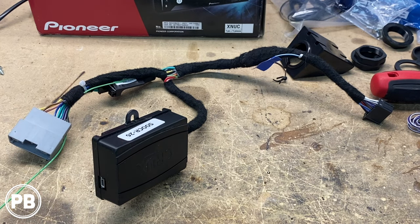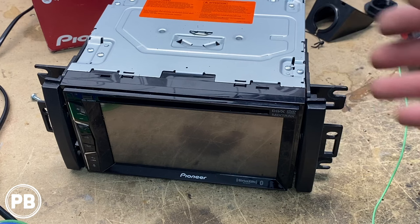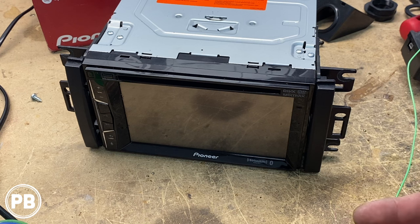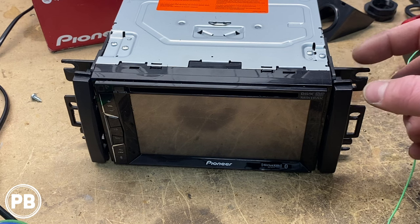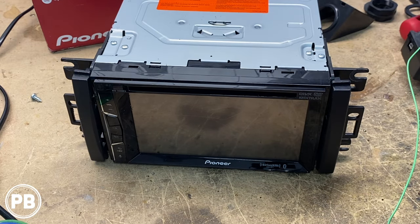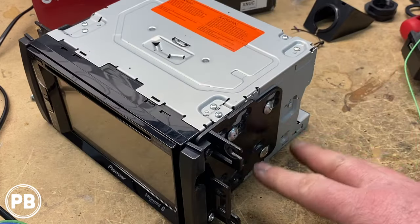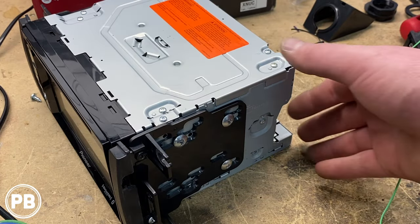Let's turn our attention to the dash kit. It's not our favorite dash kit style, but it's available for this vehicle. It's basically a left and right bracket — you screw either one set of face plates or the other. There are two sets in this updated version; you just have to see which one fits best. The thicker ones are for kits with a deeper bezel. Since this one is super shallow, we use the shallower ones. It was used on the other radio previously installed, but we spent some time modifying it to make sure it sat nice and flush. Our dash kit is done.